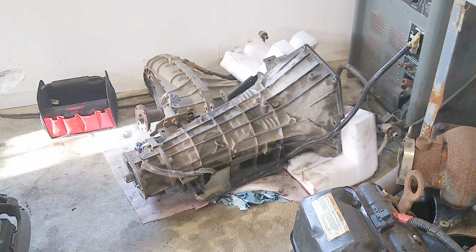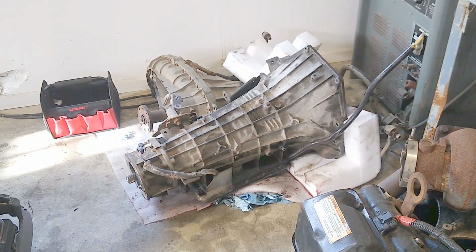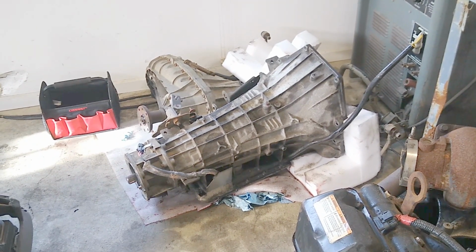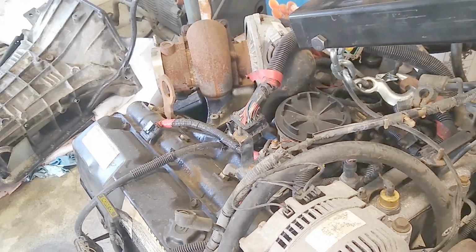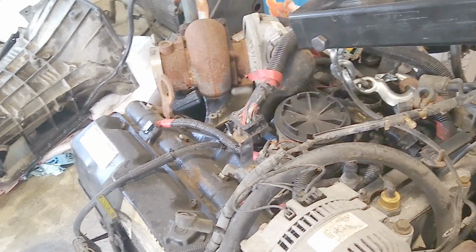I had an automatic transmission, but then I switched to a manual transmission because of preference. You can use the automatic transmission ECM with a manual transmission, but this can cause some wonky idle and throttle pedal issues, as well as constant engine trouble codes. So the option I went with was to mail my ECM to CP Addicts in Tennessee for reprogramming. About a week and about $190 later, I had a manual transmission ECM.